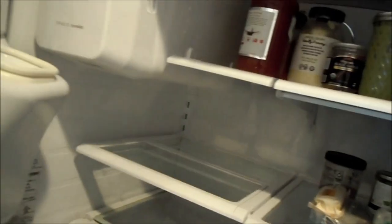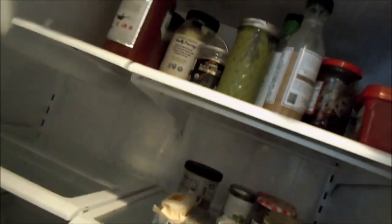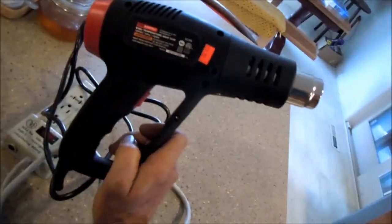Okay, here we have the dreaded Samsung with a defrost issue. That frost built up in there. We got it unplugged. I'm going to have to take this back panel off, make sure it's all defrosted, check the defrost drip pan, make sure it's flowing, and clean this lint out.